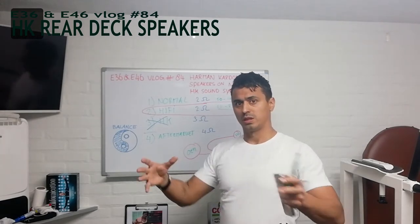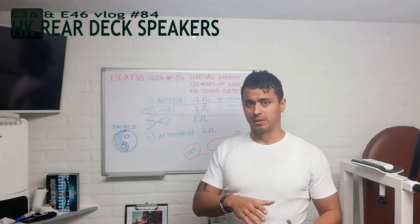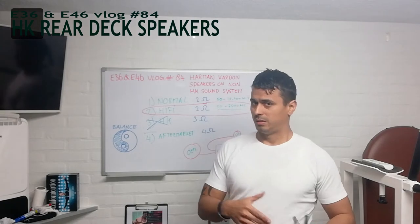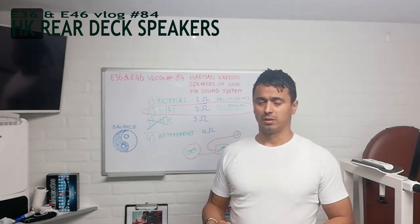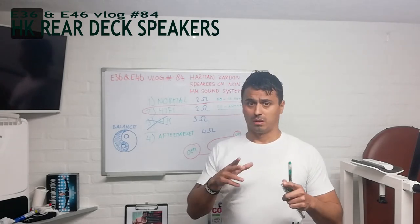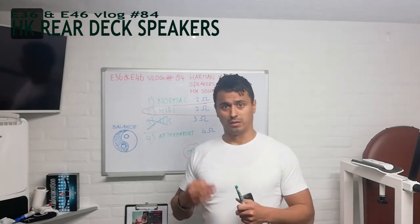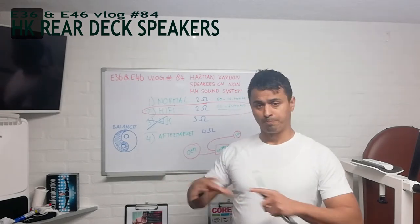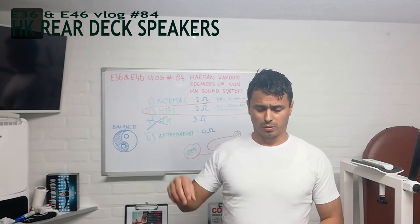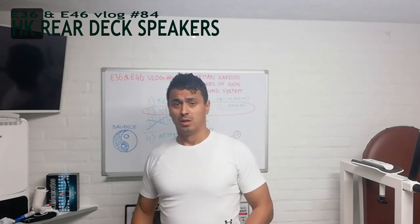What that produces is more sound into the area where the speakers come out. If you don't have an amplifier, you really don't need the Dynamat. If you do the Dynamat, make some molds out of carton and do it really nicely with a roller. I did it at my door panels last time and I'm probably going to do it at the front, but at the rear OEM it's already really good isolation and I don't have an amplifier so it's not necessary for me. I'm going to the garage now to put the speakers in. I have new screws, the clamps are already replaced, then I'm going to place the caps on and check the sound.